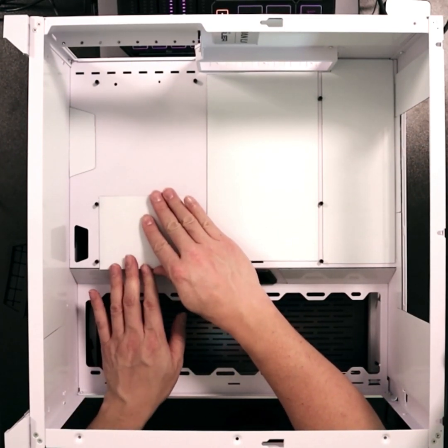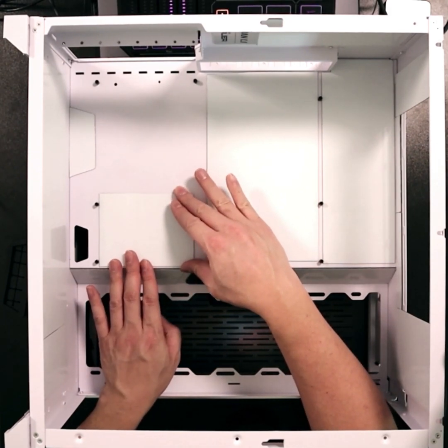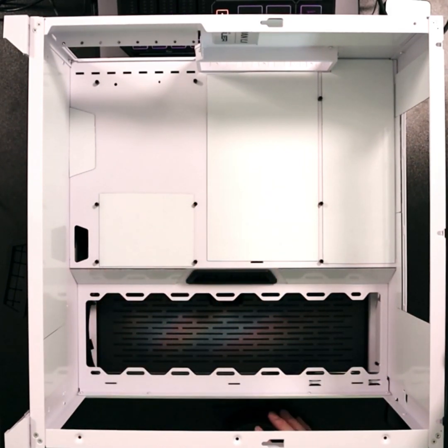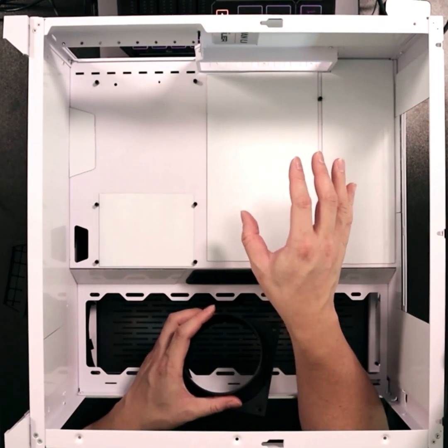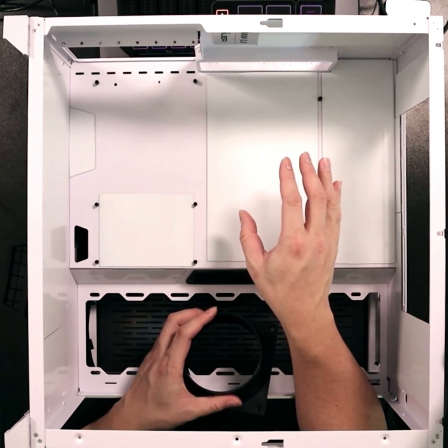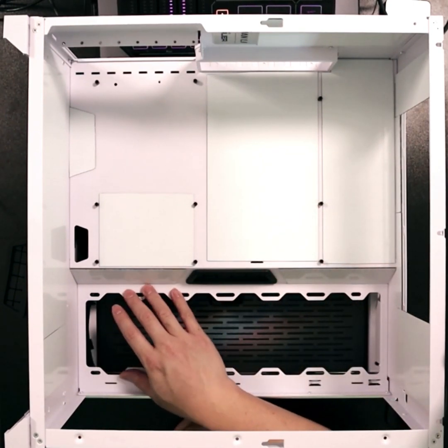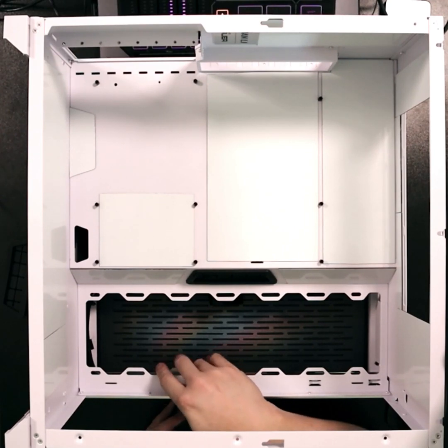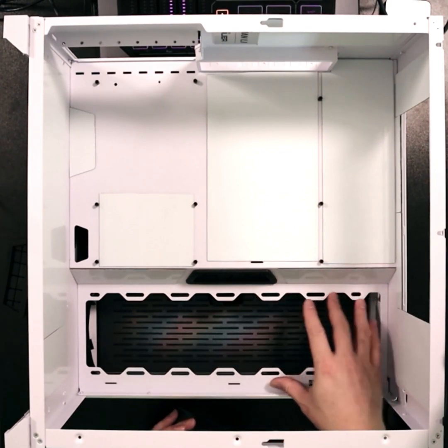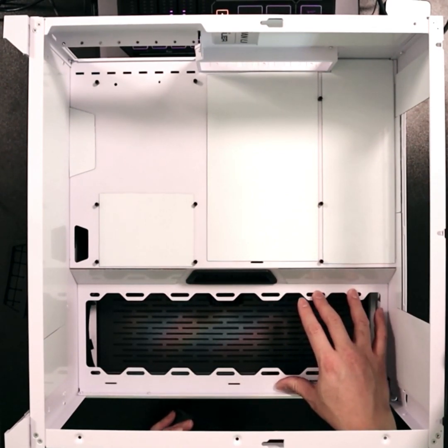I hope it works. If I wasn't going to put fans on the CPU, then I would use three. I was planning to use the Silent X 38 millimeter fans. They're 120 millimeters, but they're 38 millimeters thick, and they move 90 CFM each. So we're talking 270 CFM from the front itself.